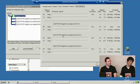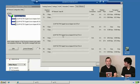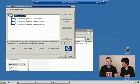So not all switches do. Maybe if you buy a cheap Netgear or D-Link, I'm not saying anything wrong with them, but if you buy the entry level one of those for your home user and they're a few pounds, you might find that they actually don't support any of those protocols, so you actually can't do any of that kind of load balancing.